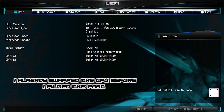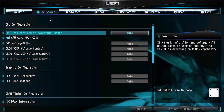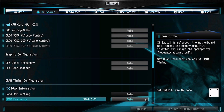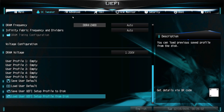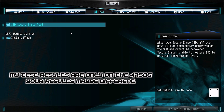Once the computer restarts, go back into BIOS and you can see my motherboard is now registering as an X300 with P1.4. There's a lot of additional stuff now added to your BIOS. I have not tested all of it, but I can confirm that XMP or any RAM speed changes are not currently working with this setup.